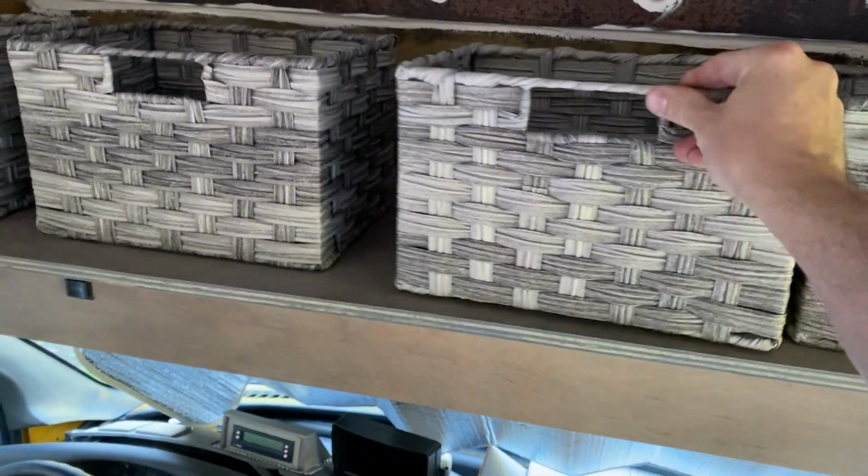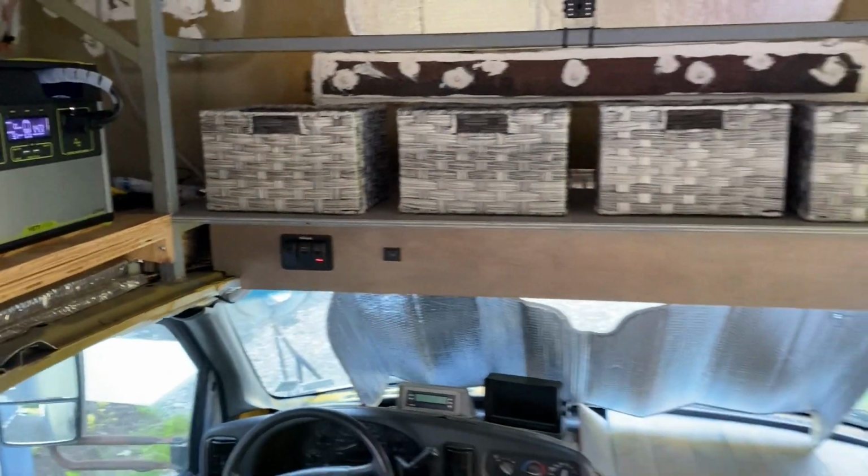Ooh, parts. Very nice. Before I can finish the woodwork with the shelving and everything, I actually have a layer of insulation that I want to put up against here. I'm going to be using Reflectix, which is a double bubble, double foil system. It's designed typically for houses, and if you set it up where there's a layer and then an air gap and then another layer, you get something like an R20 or R40 rating. The layer itself is only worth about R3, but I'm hoping that the reflectivity will be just a supplemental thing. Pretty much just like the more we throw at it, the more we're going to get.